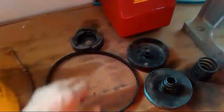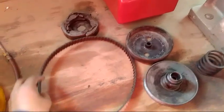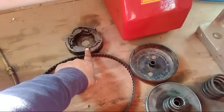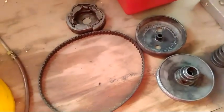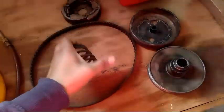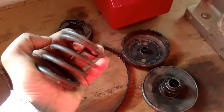When the handle vibration comes, I told you that the handle vibration depends on three things: the variator balls, the belt, and the centrifugal unit wear and tear. And if I talk about the fourth one, the retainer spring tension is reduced. When the tension is reduced, the vibration issue is also created.